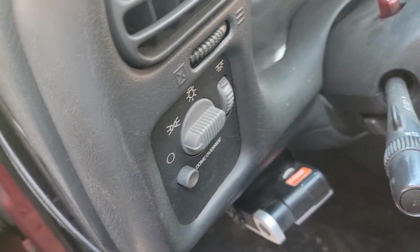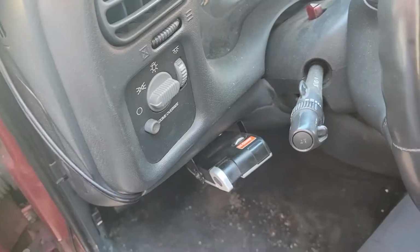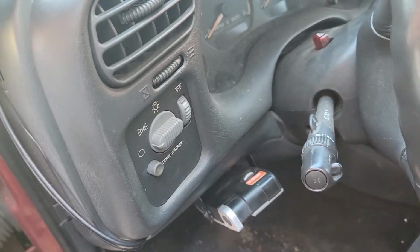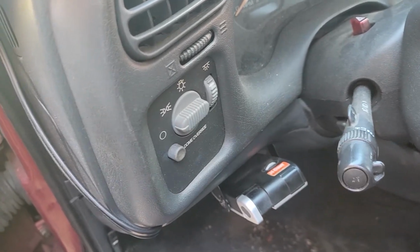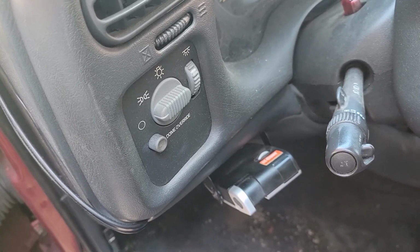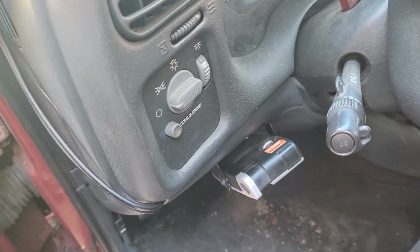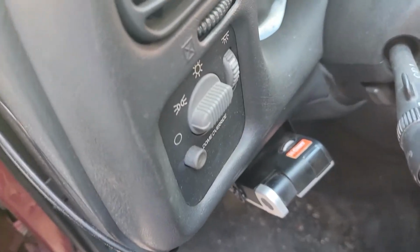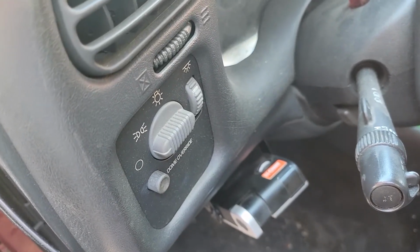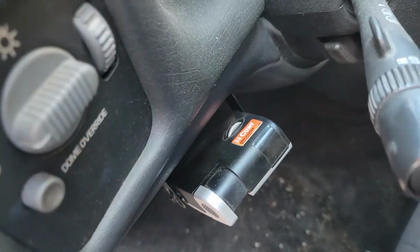Just wire your plug in the back. This does not have that. You have to run everything. So, for this brake controller, you're going to need 4 wires. And for all brake controllers, you're going to need 4 wires. One is a power, two is a ground. That's for your controller. That's what feeds the controller. Third one, you're going to need a trigger wire. That's going to be from your brakes on the vehicle to trigger the brake controller to send power out to your trailer. And fourth is that wire going to your trailer. That one itself is usually blue in color.